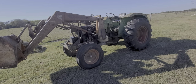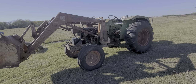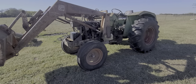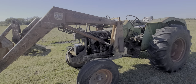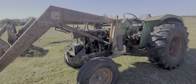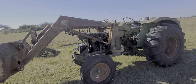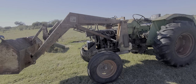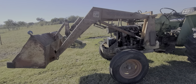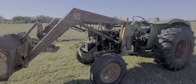The engine is surprisingly in good shape. The transmission, I pulled 2 gallons of water out of it, which was insane, and some milky oil. Probably that's why they had some grind over there, likely. But the engine had no signs of water whatsoever. There was a good oil in it, and not extremely black. It was black, quite black, but bearable.